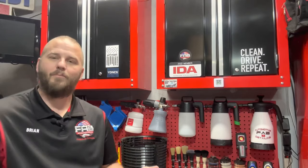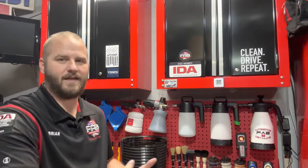I don't want to make this a crazy long video because it is just a video about grit guards, but I think it's an important one because we kind of overthink this stuff. What did we do before grit guards? We still washed our cars, and if you did it properly you really didn't have a problem. I didn't have problems with swirls and scratches before grit guards came out. But for the price they cost, and they do work, it doesn't hurt to be extra safe. Most scratches during the wash process come during the drying phase — that's where your drying aid comes in to put lubrication between the towel and the paint.